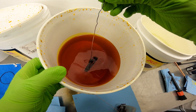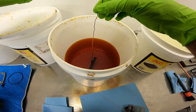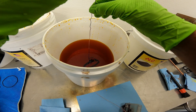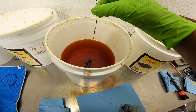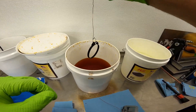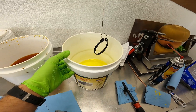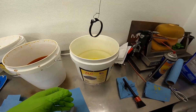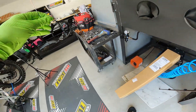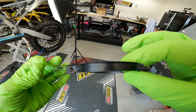Oh yeah, that turned black immediately — I've had amazing luck with Yamaha parts. The quality of the zinc coating is just amazing. That's been about 15 seconds — we'll pull it out at about a minute. This is how I've done 95% of this bike, save for things that are stainless or aluminum. At about one minute — there you have it, came out perfectly. Really good luck with Yamaha parts having a high-quality coating of zinc, not spotty at all. That is beautiful.